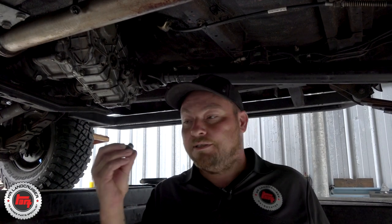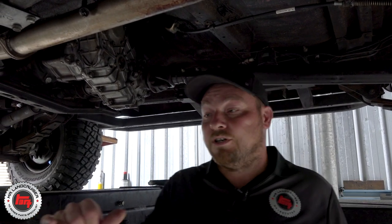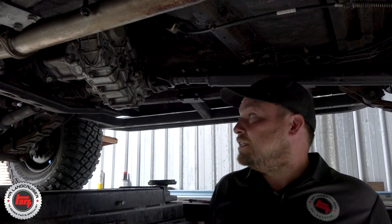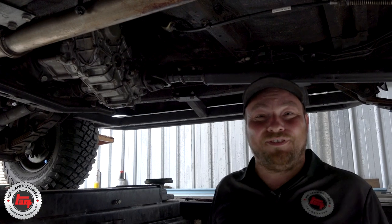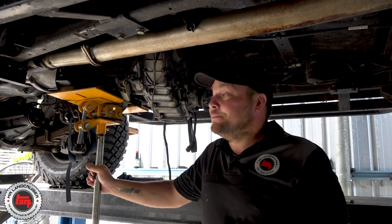You've got your magnet in the sump plug — you'll see there's a little bit on there, but you're looking for big chunks really. It gives you an idea that there might be something deeper going on in there, but I know that the customer on this 60 services it regularly, so the oil came out quite clean and we haven't got a lot of material on the magnet. I'm looking forward to getting inside this to see what's going on because it is a noisy gearbox — hopefully it's just wear and tear given the vehicle's done over 650,000 k's.